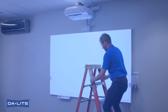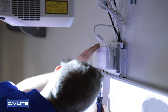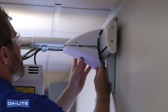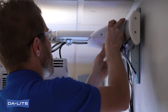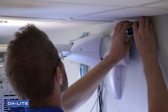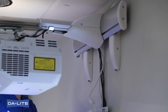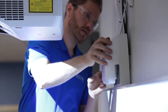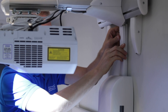Adding Covers. Reattach the touch sensor cover using the retained fastener still remaining in the cover. Lower the upper cover onto the projection mount. Raise the lower cover to the projection mount and fasten through upper cover, lower cover, and into wall mount with two 8-32 by 1/2 inch Phillips pan head screws. Place wall bracket top covers over top of each mounting bracket arm. Secure wall bracket top covers to wall bracket arms by installing four 8-32 by 1/2 inch Phillips pan machine screws through holes in covers and wall bracket. Repeat for remaining wall bracket arm. Lower AN3 sensor cover over touch sensor, placing bottom tabs in channel on top of screen frame, clicking it into place. Attach cable channel back to wall vertically between the projector mount assembly and the touch sensor cover.